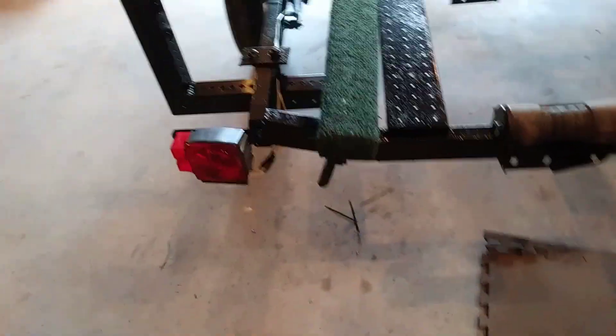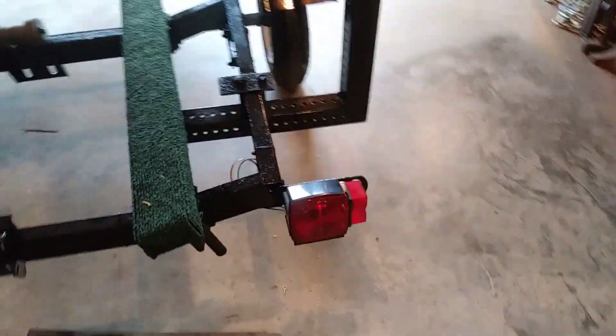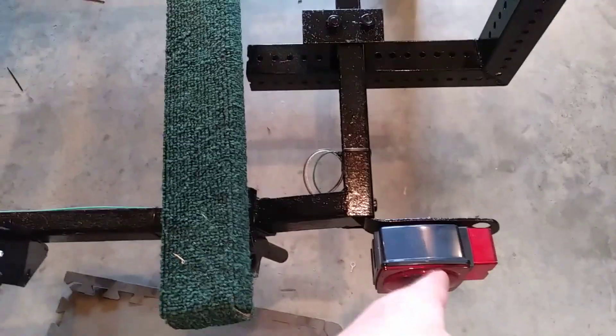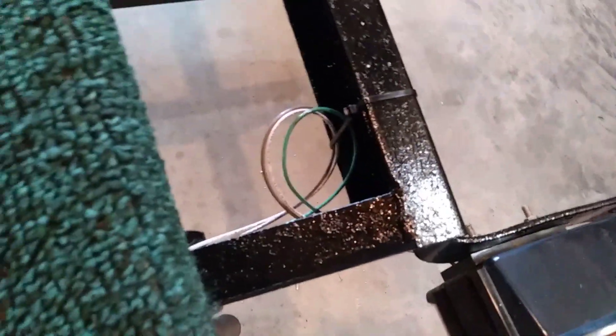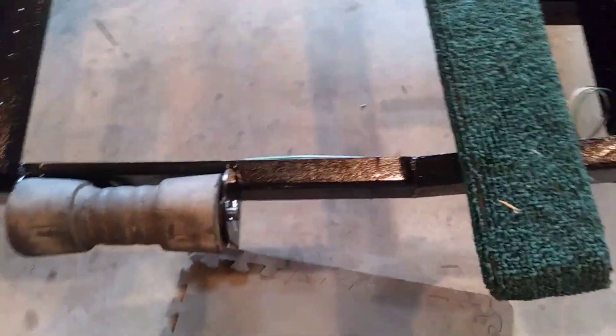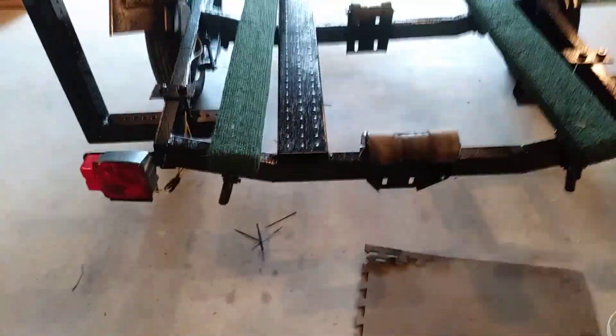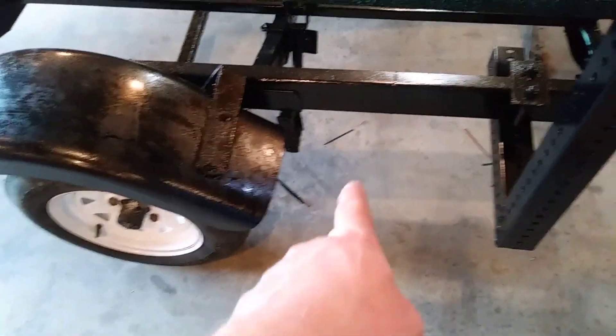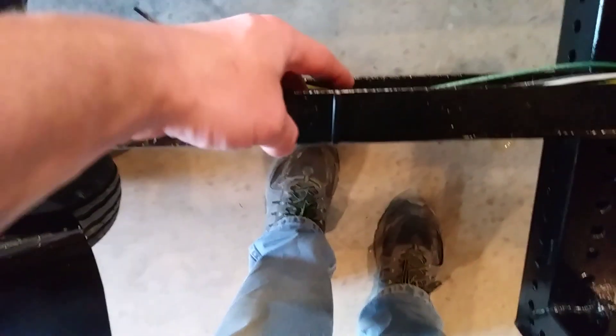You can see I've got my taillights mounted up there with the wires peeking out from behind them. I left just a little bit of loop in case I ever have to rewire a taillight. I try to capture all the wire inside the frame to keep it from getting pinched — if the trailer hits a rock or the boat comes in funny, you don't want to pinch your wires. Do the best you can to keep them tucked up out of the way. I just use wire ties to capture them inside the C-channel and keep them away from sharp edges.